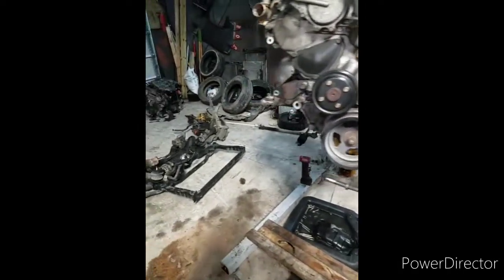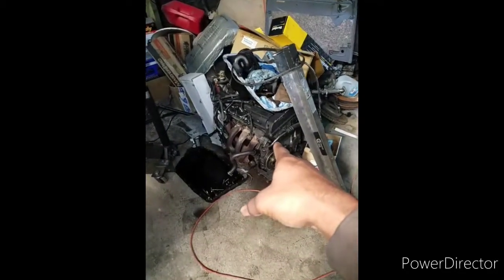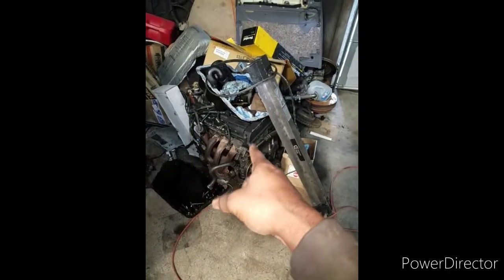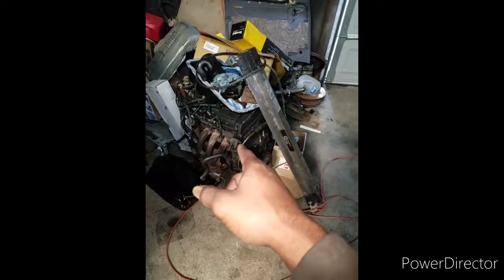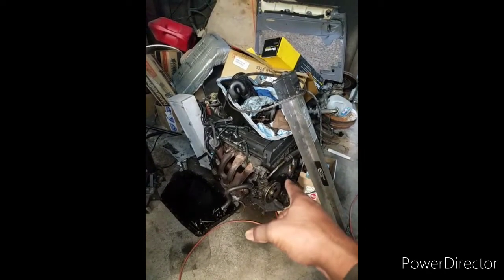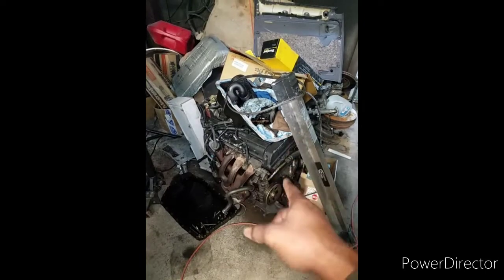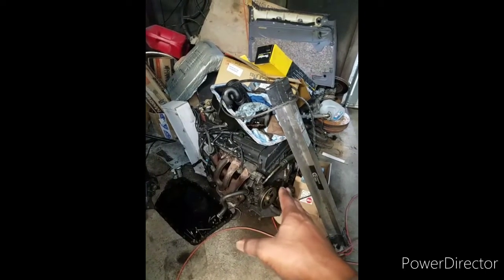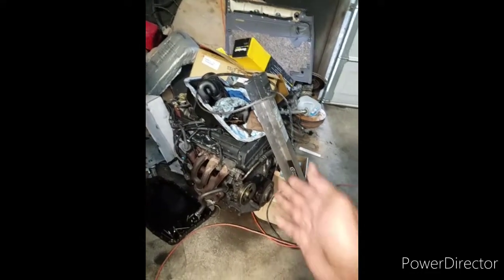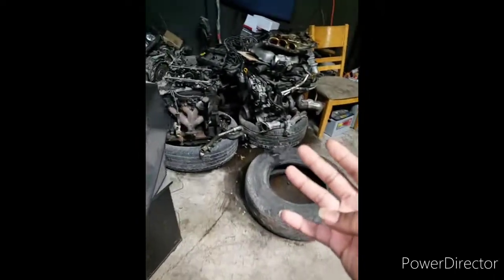This is AK. As you can see, I've been away for a little bit but I've been working — I just haven't been videoing anything. I went through a Honda CRV while I was away and knocked that out. That one had cylinder number four dead on it, so I put another Honda motor in it. The motor I sourced actually had a bad timing belt in it — it busted. I bought it from a yard saying it was a good motor, started to put it together, and realized the timing belt was busted, which means it's got bent valves — no good.